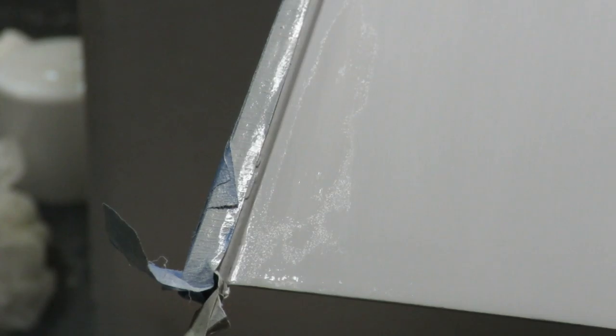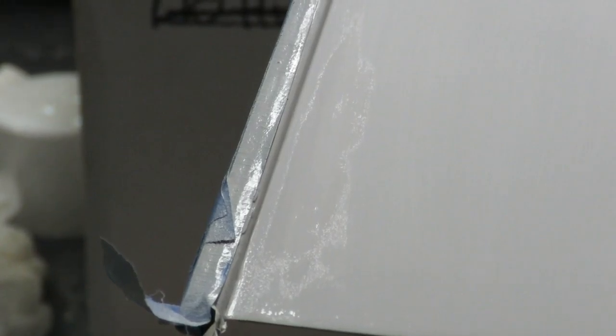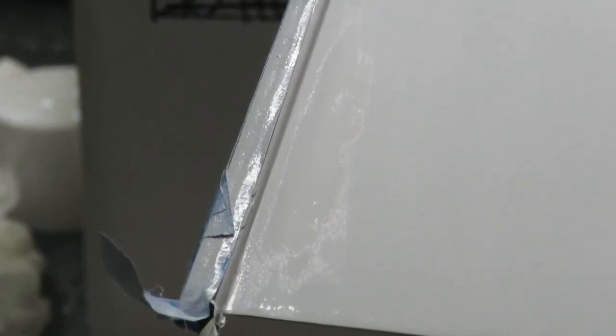You have to have the reflection exactly right to be able to see it even, but you can see at the front there, I have sanded through just that short area there. And I'm going to tape it off and then respray it and let it sit overnight, and then it'll all be good. Now in taping it off, I'm going to use rolled tape, fairly wide blue tape, and then I'm going to roll it with sticky side out.